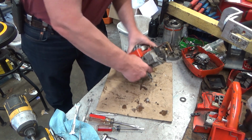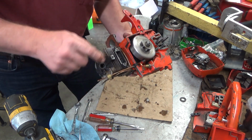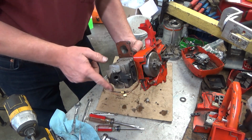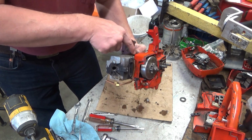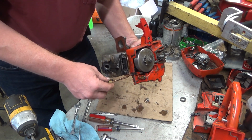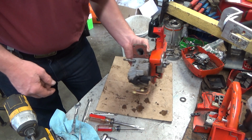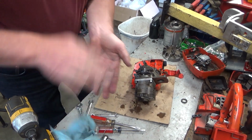Okay, so you want your lines arranged so that they're doing that. You want the discharge line, which is the inner one. It sits in a groove between the cylinder and the drive case, and then should be just routed right along there. This one ideally is straight under the muffler and out to the back. So, let me grab a few parts.